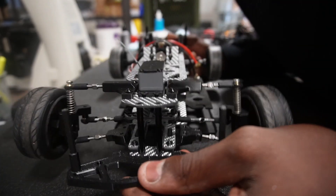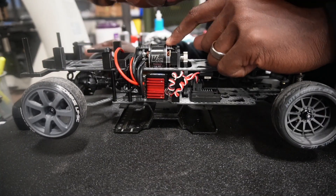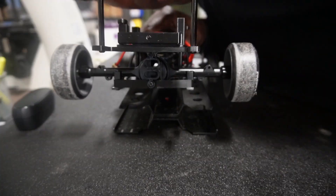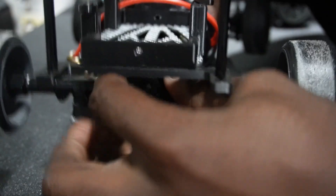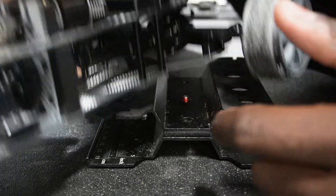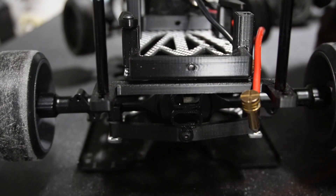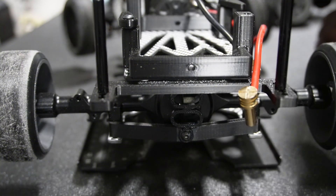This is the Bingo RC Hachi chassis and the actual motor is up here. In the axle — front and back — there is a bevel gear inside of the axle housing. To get to it, you have to take the screws out, drop the axle, and there's a bevel gear inside, just like on the GRK. Same thing: take it out, flip it over, put it back in. Rotation is good.